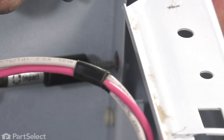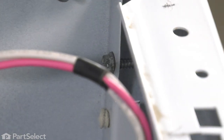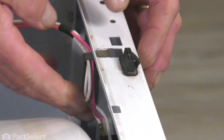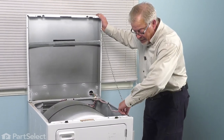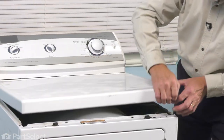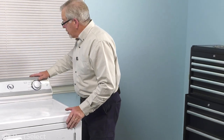Then we'll reattach the second mounting screw. Next, we'll take that harness retaining clip, tuck that into the opening in the top of the front panel, and snap it into place. Make sure that the wires are away from the drum. Now we're ready to put the main top back down. We'll disconnect our lanyard and replace that rubber bumper — just fit it back into that opening on the top of the cabinet. Then we'll lower the top down carefully, making sure that we engage those two clips. We're then ready to push the dryer back into position. With the dryer back in place, we're ready to reconnect the power, and your repair is complete.